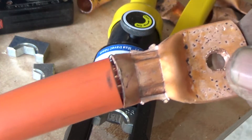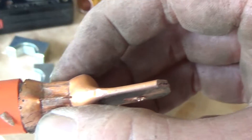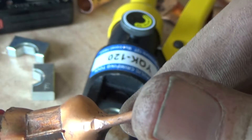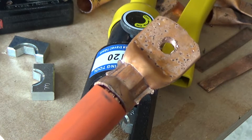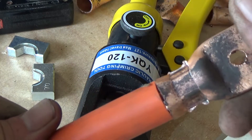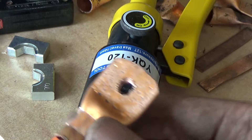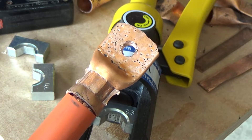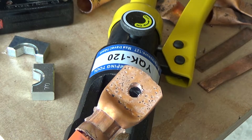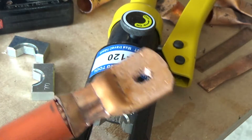And that's the end result there. It's clamped up tight. You can see it's actually clamped smaller than the original diameter of the cable so it's now fully compressed. And it looks pretty bloody good. I'm pretty happy with that. I do want to insulate that somehow — I'm not really sure how yet. Maybe I'll consider this one to be an earth cable and worry about that on my positive leads. But I don't have any shrink wrap that'll fit it.